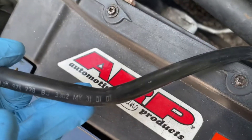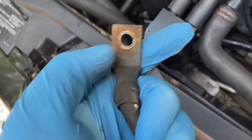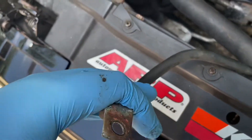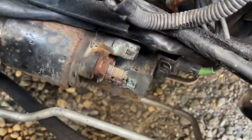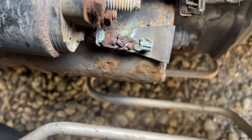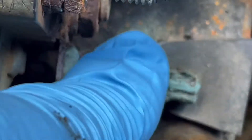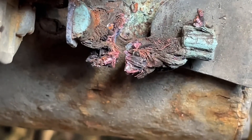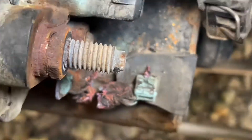Got the head off — here's my cable, you can see it's wearing out. We're gonna clean the ends off, get it nice and clean. You can see what failed on the starter — I touch it and it's separated. That thing finally let go. It's been screeching, all rusty. You can see all the rust on the starter, so it's had a good life.